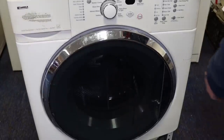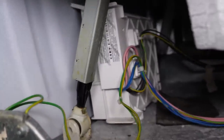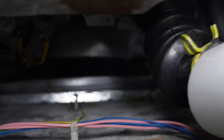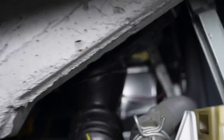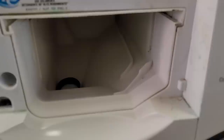Finally, we have the last washing machine in this batch — a Kenmore HE2, quite old. Some of these units have kick plates underneath that let me look inside. Visually, there's a little bit of rust but nothing that looks very problematic. If you see major rust spots, it would signal that there is a leak in the valves or a hose somewhere, and that would be absolutely horrible if you tried to install it on hardwood floors and ended up damaging them.